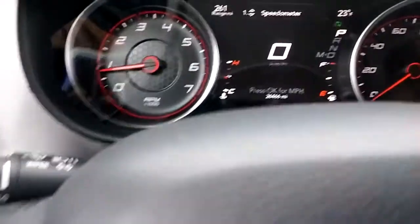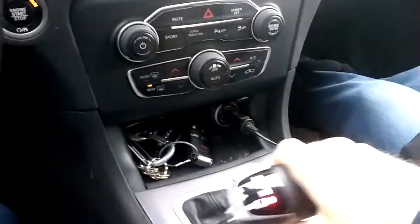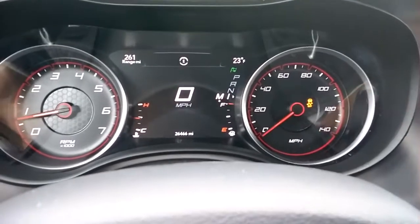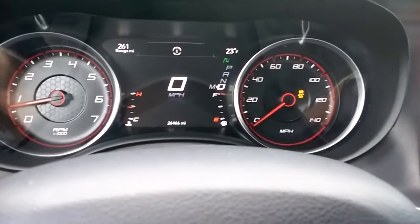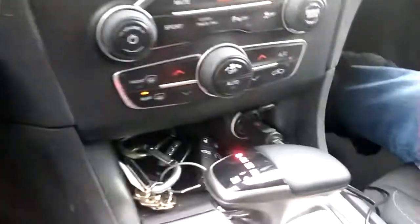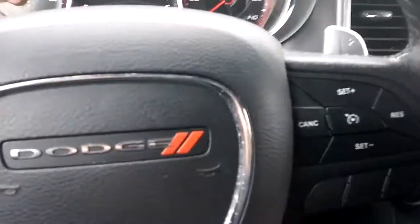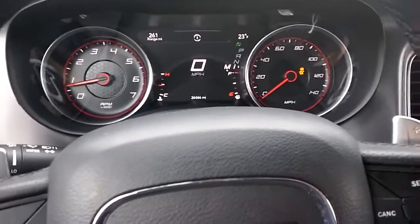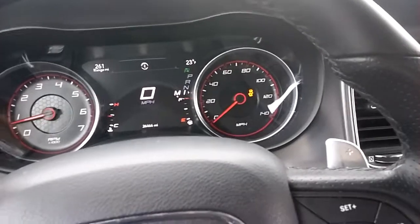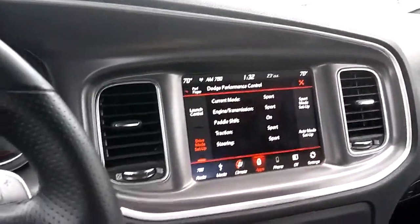When you go ahead and put it into manual mode, see how it's red? That tells you you're in manual. You can actually start out in second gear for traction control purposes — it won't let you start in third. The difference with paddle shifters in manual mode versus regular mode is that in manual it stays where it's at, whereas in regular drive mode it'll go back to where it wants to go. So if you're doing autocross or racing on twisty roads, we put everything in full manual mode for total control of the vehicle.